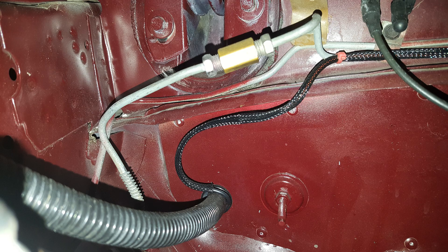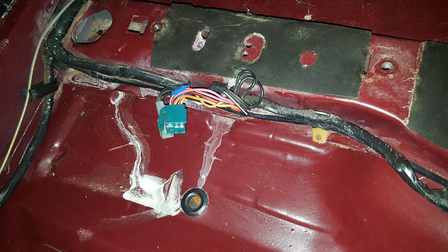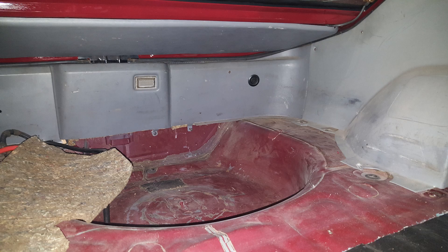The fuel pump relay wire will take a different path. Because you only replaced the fuel pump in the tank and did not start an entire new wired system to run it, you will retain and be able to use all of the factory wiring and components, as well as the inertia switch safety system. This will save you time, money, and possibly save your life in the case of a rear collision.